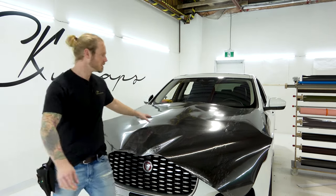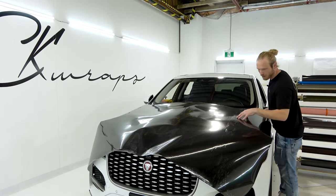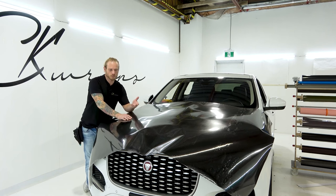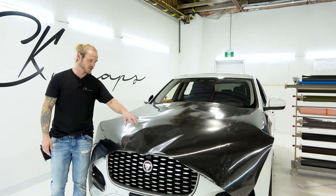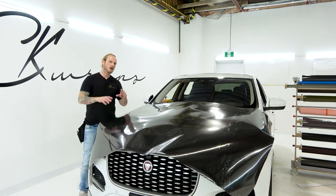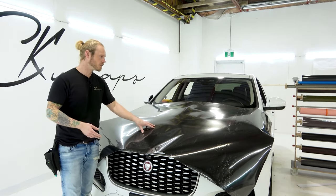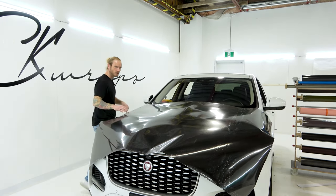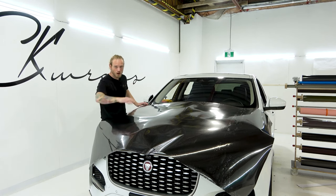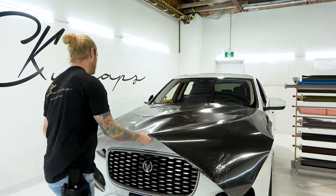This film is more prone to getting water between the laminate and the carbon fiber. The reason is due to an exposed edge. If we wrap around all of our edges and corners really nicely — which we're going to do in this video — we don't have to worry about an exposed edge, other than a stone chip. That's why we're going to PPF it. The cost to wrap the hood and PPF over top of it is going to be cheaper than a real carbon fiber hood, and with the PPF your hood is going to be scratch proof.